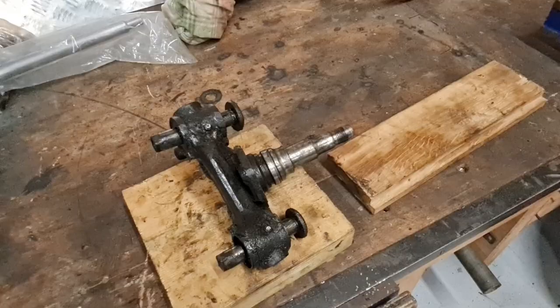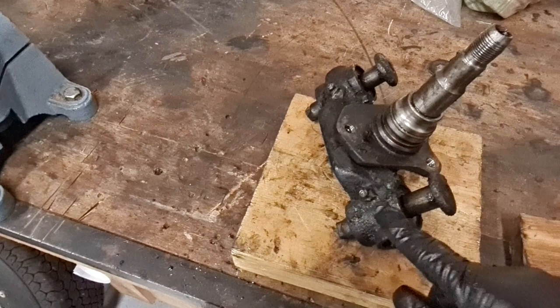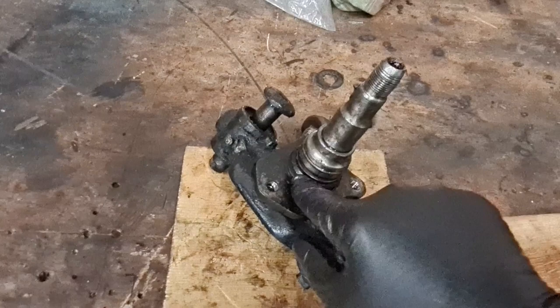This is our king and link pin assembly off of the vehicle. These are our link pins — these pins go through here, there are bushings in here, and we have shims either side which help us determine the right angle for our stub axle. In the center goes our king pin, and that's where we've got wear at the moment, so our stub axle is moving when it's on the car.